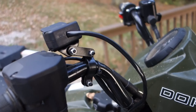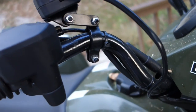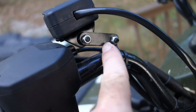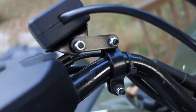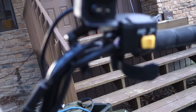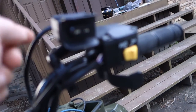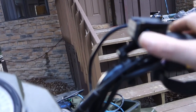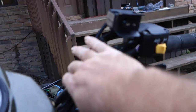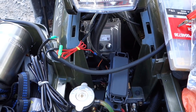The switch is now mounted on the handlebar. The instructions covered wiring but not the physical switch mount. It uses two half-moon parts that wrap around the bar, a short bar, and a plate that mounts on the bottom of the switch. Once mounted, I've got it running behind the wiring — with my hand on it I can easily actuate it — and I'll run the wires down and wire-tie them to the handlebars.